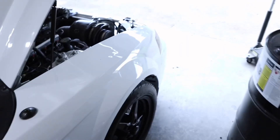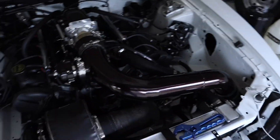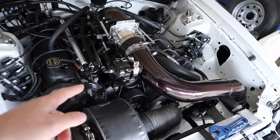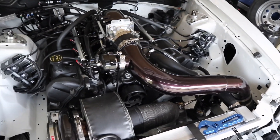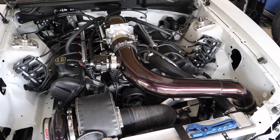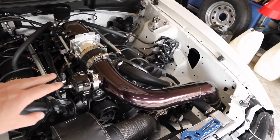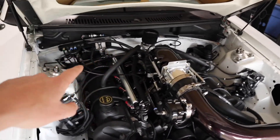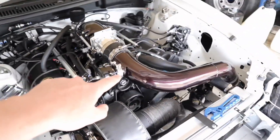I've got to pull some stuff out from under the hood — I need to pull this intake pipe off and pull the alternator off so I can get to that fitting down there in the valley of the engine block. Then I'll get the sensor plumbed in and run my wire under the intake, through the firewall, and into the car to wire it up to the ECU.